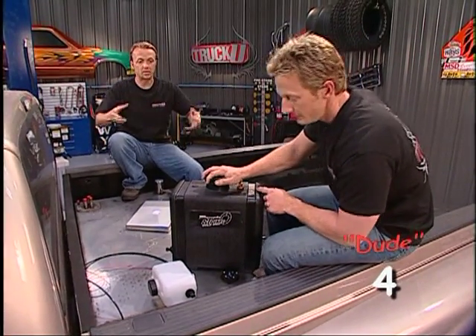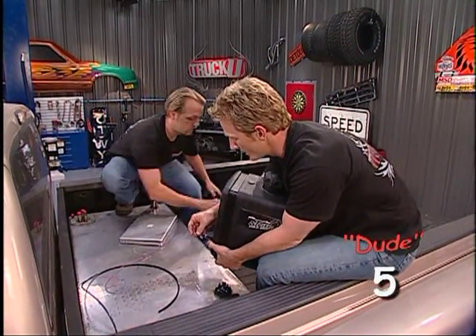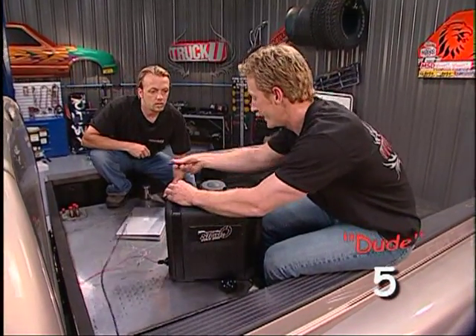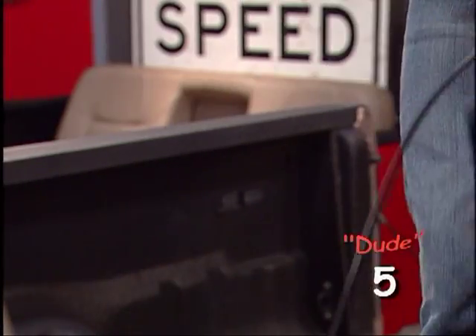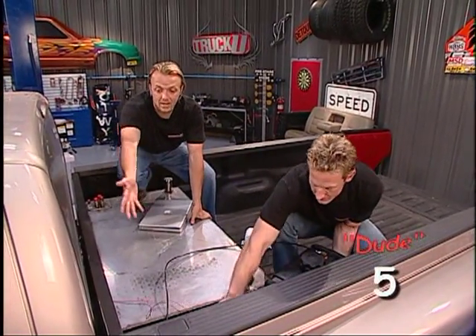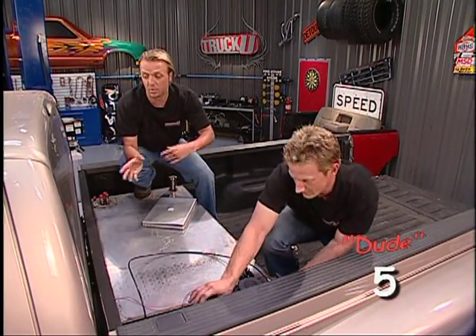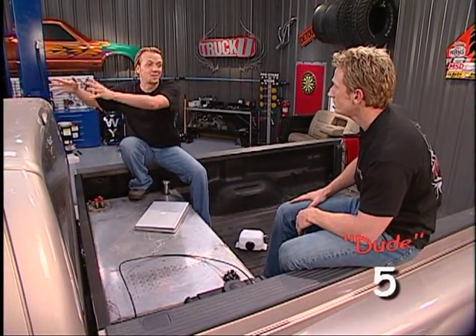Now all we have to do is plumb that up and get it ready to go. I've got to make two little connections here - one's our electrical, and next I put our supply line on going to our fuel pump. We've got the pump right down there that shoots it up to the front. The reason we mounted that pump in the back of the bed is that pumps are designed to push, not pull. If you've got it up front it's got to suck all that fluid up and you're gonna burn through a lot of pumps. So gravity will feed the pump and it'll push it up there.